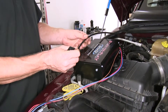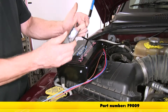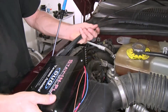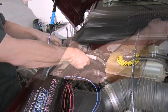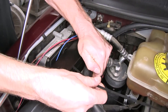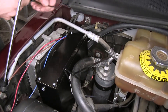Let's work with our airline tubing that will go to our cylinder. We'll connect this end to our operating unit. Before we do that, we'll put a fresh end on there using a tubing cutter - part number F9009. Then we'll install it into the back of the operating unit, push it in until it stops, push it in again, and you're good to go. Now we can put our operating unit in for good. Let's route our lines where we want them, push it down into place, make sure it's next to the connectors, and zip tie to this line right here - just enough to keep it secure.